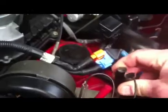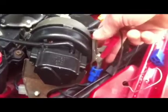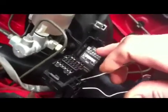For a timing light you're gonna need power under the hood. Since the battery's in the trunk, you can get ground under the hood anywhere - I just ground right here to the cruise control bracket. There's a little blue plug under your hood that'll be a constant power, a battery source you can use to hook up your timing light to. On your diagnosis connector, you're gonna need to stop the computer from trying to correct the timing, or else the computer's just gonna take over and keep trying to correct it. What you have to do is ground it out - there's two pins in there.